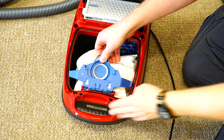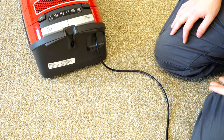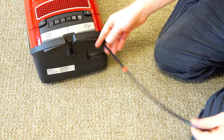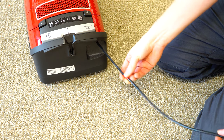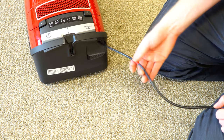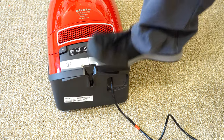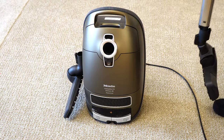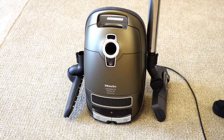Remember to reseat your bag always before closing the lid. If you feel you are a hard user on the machine, I recommend getting some colored tape and marking the end of the cord rewind, maybe about a foot from the end, so you don't over-pull your cord reel. It's a solid practice for any vacuum cleaner. The C3 has a one-touch cord rewind, which means you touch it once and it will retract.